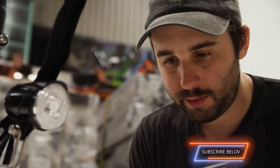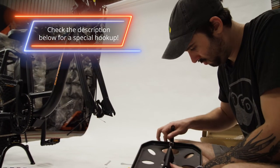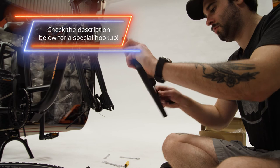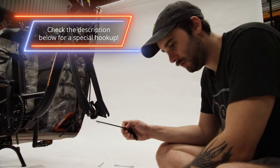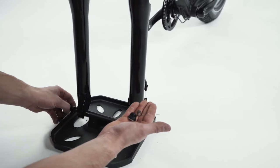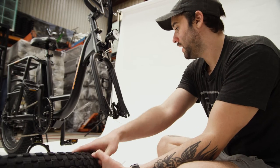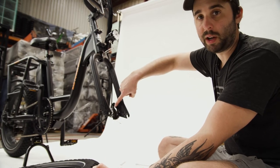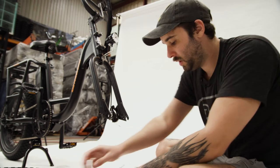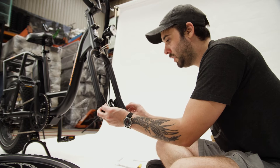Step six: check the front wheel quick release. Ensure the front wheel is fully seated in the front fork dropouts and that the quick release is fully and properly secured. The front wheel gave me a little trouble at first — I had no idea what I was doing. I had to go to RadPowerBikes.com/help to find their assembly video so I could see exactly how they did it, because the instruction manual wasn't detailed enough. The tire goes in this way with the brake pad on the right side so it can slide into the little brake mechanism. Once it's in, take your quick release lever, pop it in like that — easy as pie.